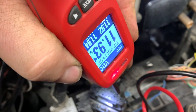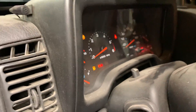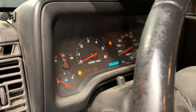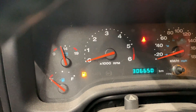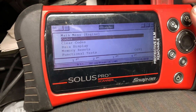So now I've got it jumpered — pin number two now has power. I'll plug this back in, turn this on, and everything should work. The sentry key has gone off and is staying off, which is good. I'm reading volts now, which I couldn't before.